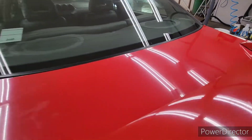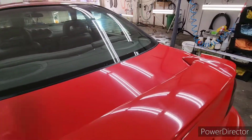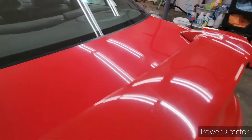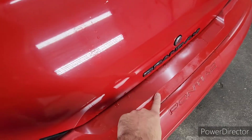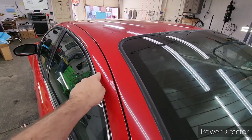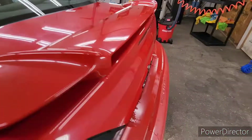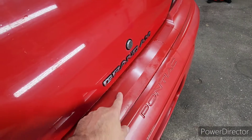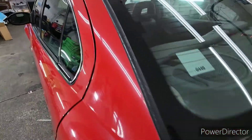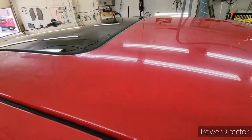It's a cool video because I rarely get an older vehicle like this in here. If this car was built in 2021 and we could go 20 years into the future, I think most likely the roof definitely would look like this, and the sides would probably still be intact, but right around the lower areas you'd be seeing what we're seeing on the bumper — that white haze. From there up the clear coat would be gone, just like here. It kind of goes from the top down — it's almost like you're peeling a sheet back, that's kind of how it works.